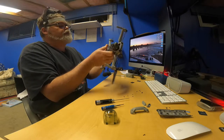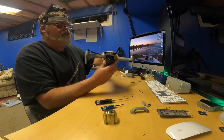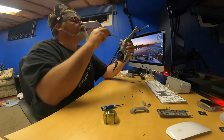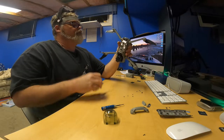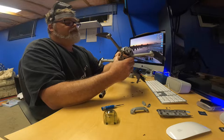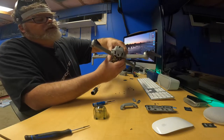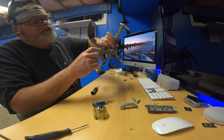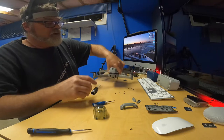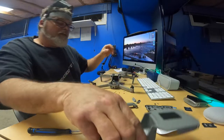When you're doing this you want to make sure you do it nice and slow and easy and gentle, because you don't want to break anything - not for a couple grand anyways. Something's holding right in the back here. Just going to wiggle it until it pops off. On the sides there's a little clip on the wing where the plastic just kind of hooks in. Get a little flat tool and slide back there and it slides right off. See there's a little hook there and a little hook there.